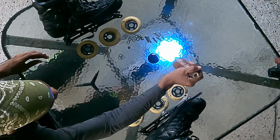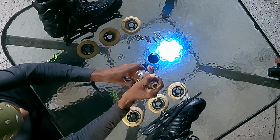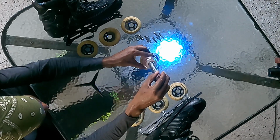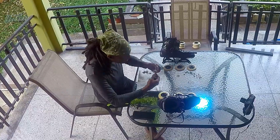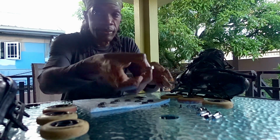The bearings should be soaking for about 10 minutes by now, so time to remove them and to drain them out. Give them one final shake, take them out, and place them open side down on your towel or paper towels to drain out. Tap them to shake off any excess solvent trapped inside and pat them dry with the towel one by one.